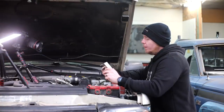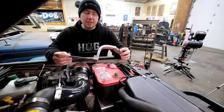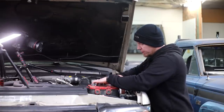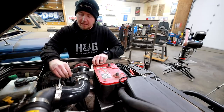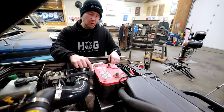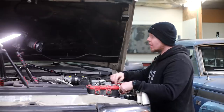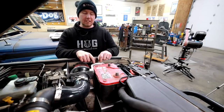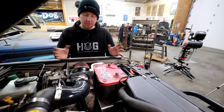This piece right here is the most complicated shape I think we are going to make today, and I'm happy to have it done. I haven't completely welded anything yet — I just have it in the shape it should be, a foundation for us to build the rest of the lid. I test-fit it on the bench and I'm pretty confident it's going to fit on the vehicle. There we go — it fits the profile perfectly. Now whenever I build the rest of the lid I have something to weld to as a flange. Everything else I should be able to make with just a metal brake, but this flange was complicated and I'm very happy I had that metal stretcher. This next part is still a little complicated because the filter protrudes out of the top of the flat surface of our air box — the filter is just too big for a space this small.